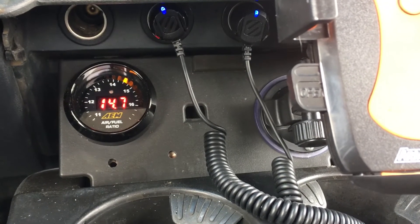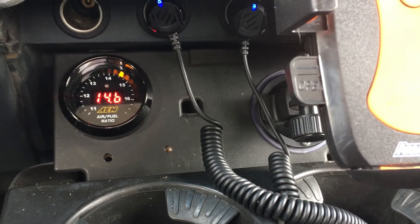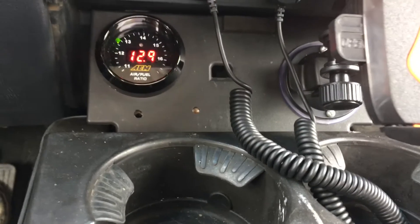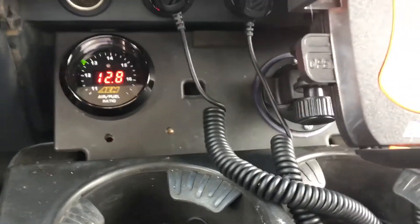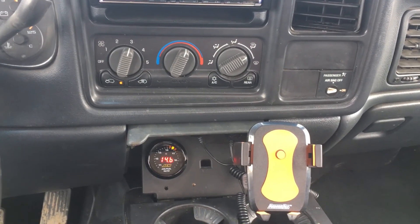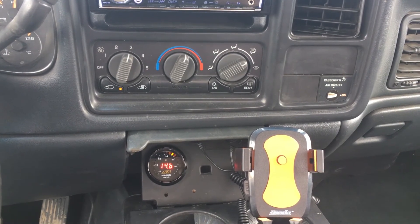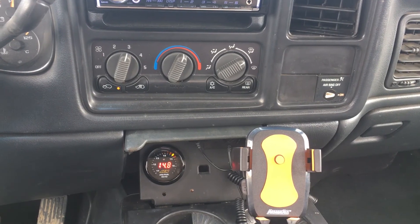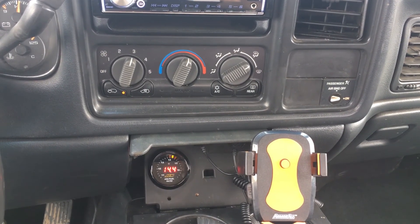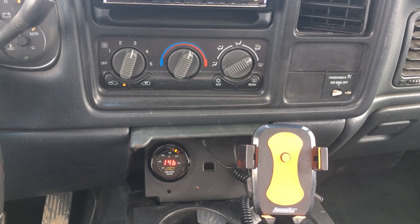I've got the truck out of the shop and on the road now. I'm going to do a pull here — I'm expecting it to read around 12 AFR at wide open throttle. The road's a little icy. I've got the wideband installed and wired and it looks like it's working the way it should. Next step is going to be hooking up that serial communications wire — I'd like to see if I can get it communicating with HP Tuners so I can log AFR and be ready for boost. I think I'll make that a separate video, so I'll wrap it up for this one. Thanks for watching — make sure to like and subscribe and we'll talk next time.